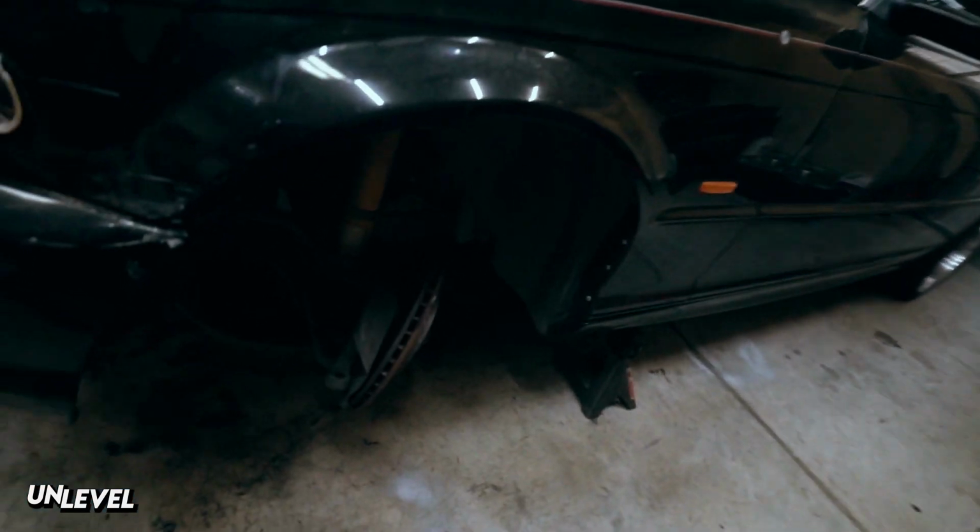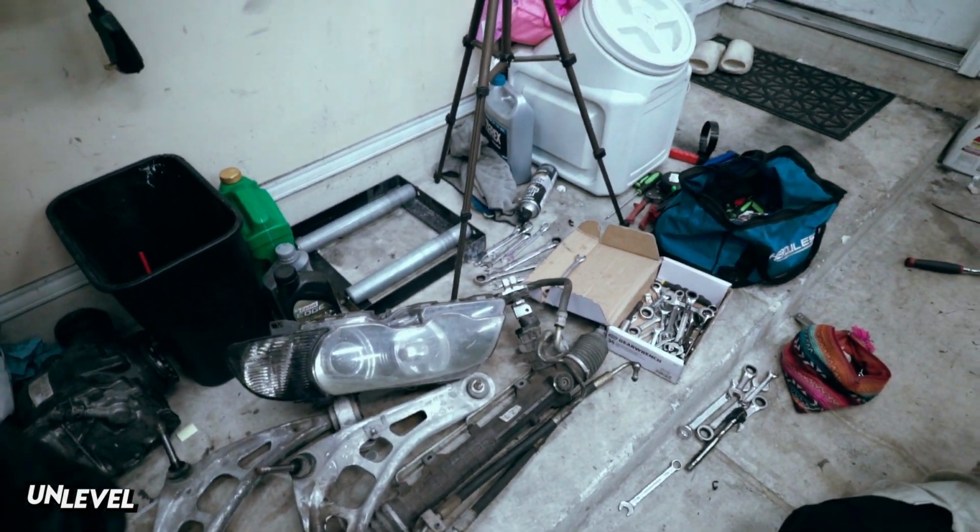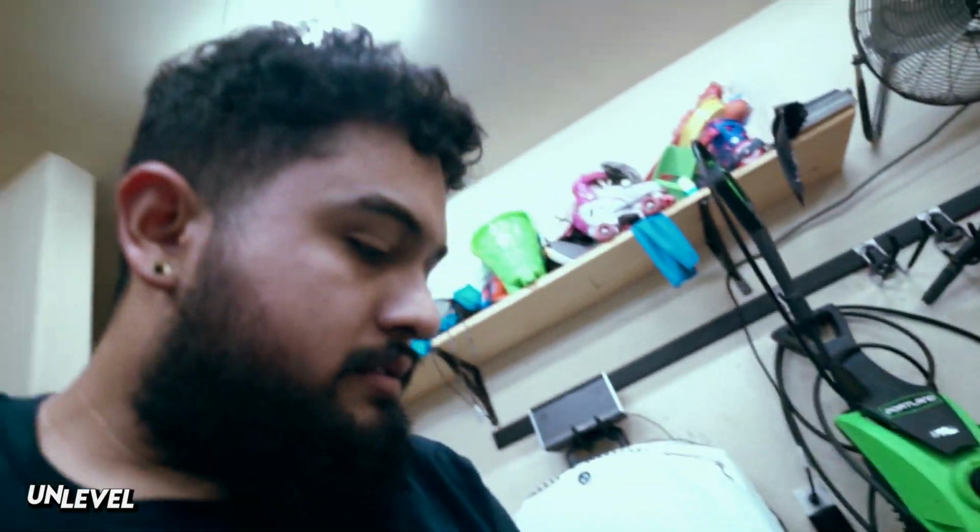We'll be back. All right, so we got the tie rods down. We got the rack unbolted. Now, what are we gonna do? Just a couple lines, drop it, put it back, and put the upgrade rack in. So this is a yellow tag from a Z3, right? Yeah, just a Z3. Faster gearing in that, so it should be a nice little upgrade while repairing his broken one.